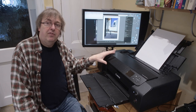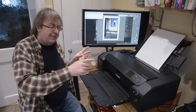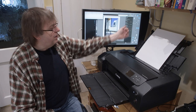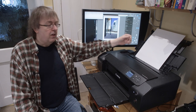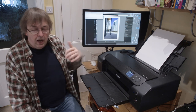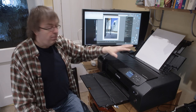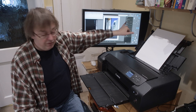That's fine if your printer doesn't move. I've been using this printer up in my office on a different wireless network to where I'm shooting this, which means it's been assigned a different IP address. When I go to the printer list, if I haven't used it downstairs, it's not in the list — it still has the assignment from upstairs. It's a bit of a nuisance because it assumes you know something about networking. But if you find a printer suddenly doesn't appear in any software after moving it, make a new connection and it should be okay.